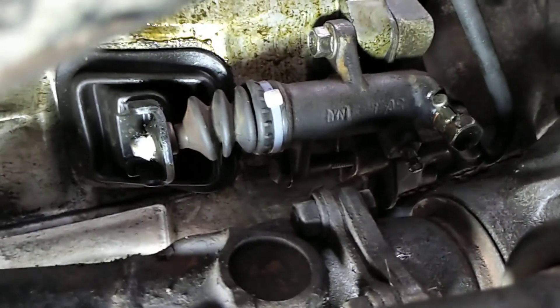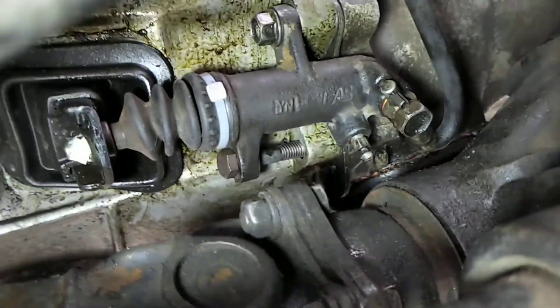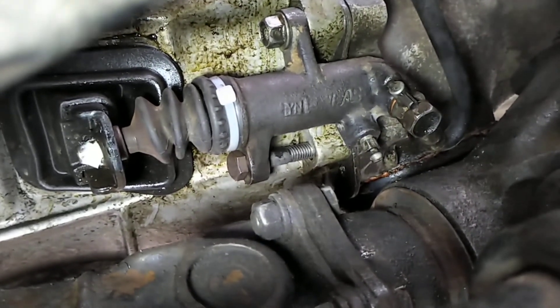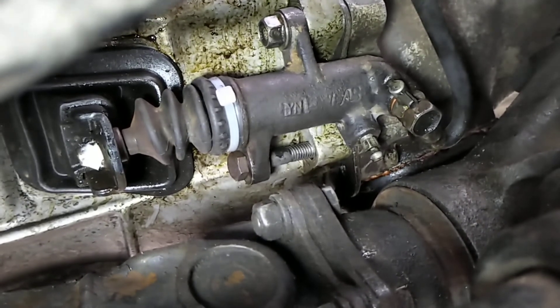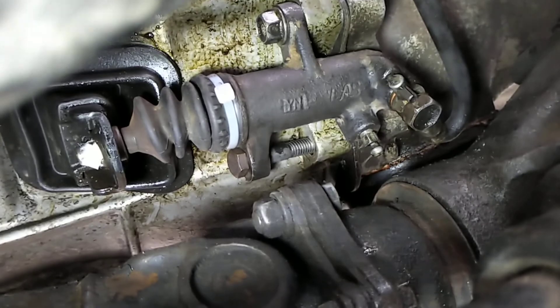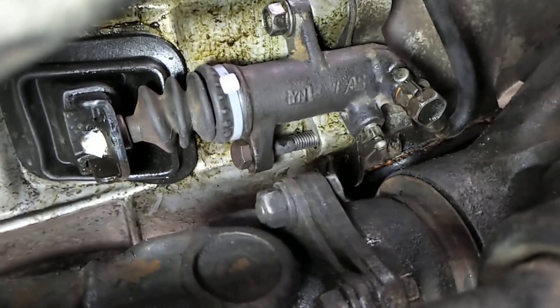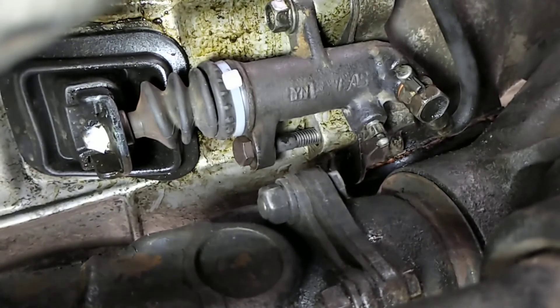You can see what I've done — Mickey Mouse, Donald Duck, and Goofy would all line up and say, hey man, that works. Here it is: it's sitting in line pretty good. You can see the hose there is bent 180 degrees, which I didn't want to do, but the retainer pin locks in that way, so I did it. And the bolt on the bottom — I didn't want to do that either, but it keeps the slave cylinder in line with the fork.